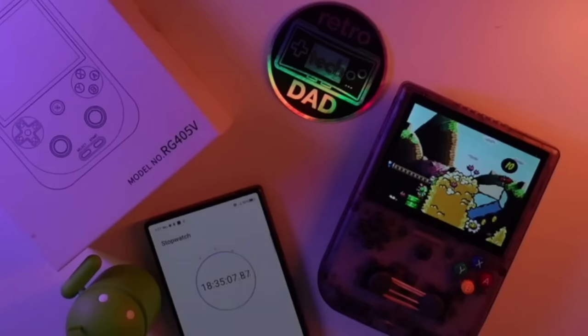Let's get a read on surface temperatures — I suspected active cooling would keep things nice and cool. I did stress testing with the fan at highest setting and then a second test with the fan turned off. With fan at max, surface temperatures stay nice and cool around the processor area — no temperatures above 35°C. The bottom half where you hold the device is a good 5°C cooler. With the fan turned off, temperatures are a little warmer but nothing extreme — the T618 actually does quite well passively cooled. You can easily keep the fan off and temperatures stay under 40°C, with the lower portion staying around 30°C.